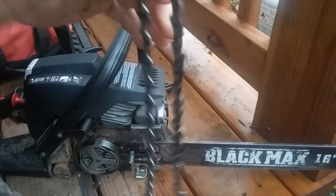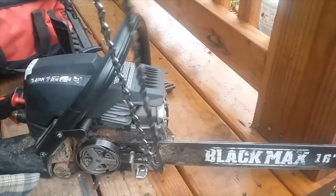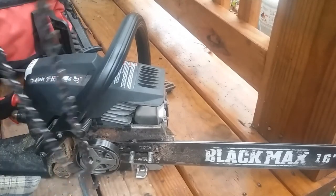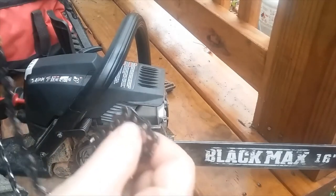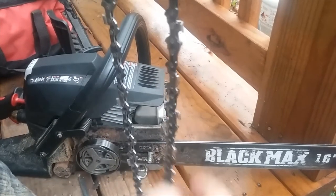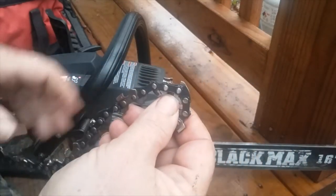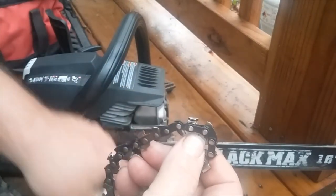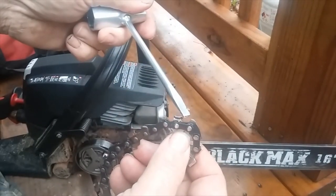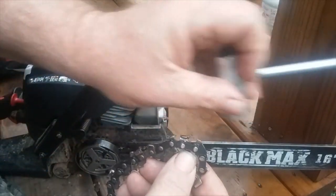Chains off. Jeffrey, I'm just sharpening that chain — I hate to put a dull one on. I'm going to put this chain back on as if it was a new one. One of the things you want to keep in mind is put the chain on the right way. See the cutting teeth out here — this is a cutter right here. It always faces on top of the bar and always faces forward.